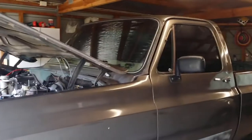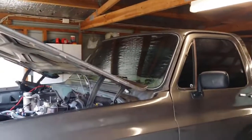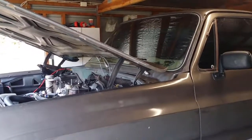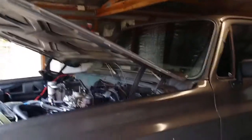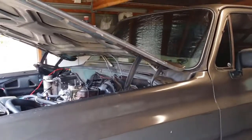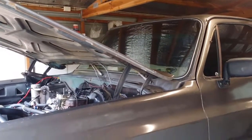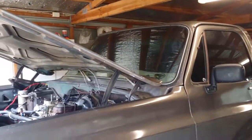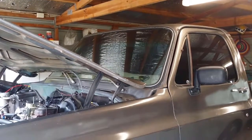Okay, we've got a Chevy C20 made in 1977 in California. The problem is that the starter motor keeps on cranking, so you'll turn the key and then you'll release it and the starter motor will keep on cranking. At this point I had to put a new solenoid on it, because when I went to inspect the solenoid, the copper and the metal bolt had welded together between the solenoid and the starter, so the small bolt broke off inside the solenoid, the copper part, so I had to get a new solenoid.